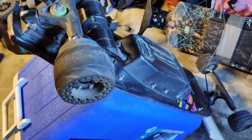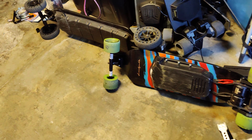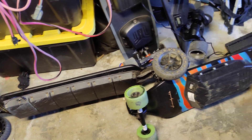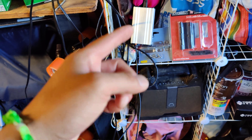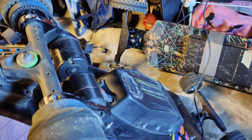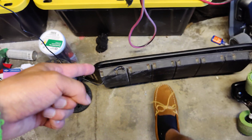If your battery has depleted all the way — especially with VESC-based stuff because it doesn't auto turn off — or if you have an Ownboard and you forgot to charge it, your battery loses voltage. What happens is these chargers all have a minimum voltage that they require, so if you're below that voltage it might not charge.